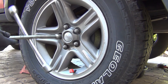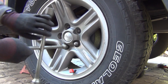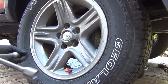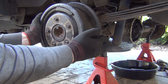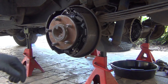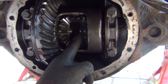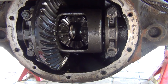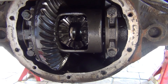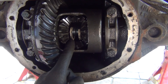Now remove the rear wheels and do the same on the other side. Remove both drums. You're going to have to push this axle inside — both sides — and that will release your C-clips. Both axles' ends are visible: the left one and the right one. Push them in and that should release the C-clips. Both C-clips came out.